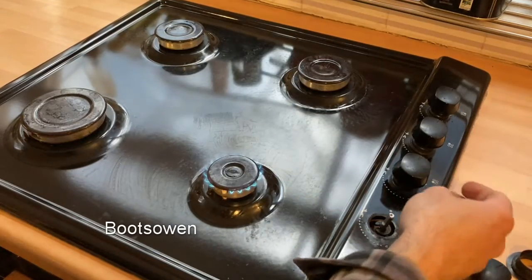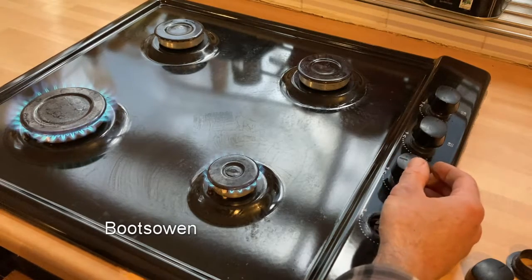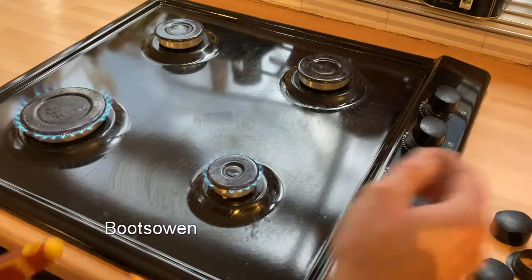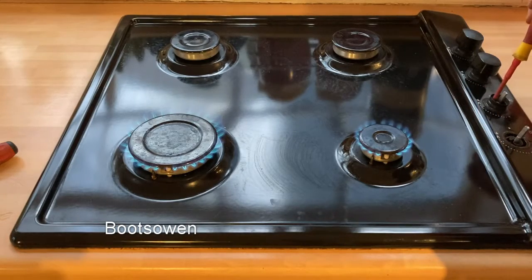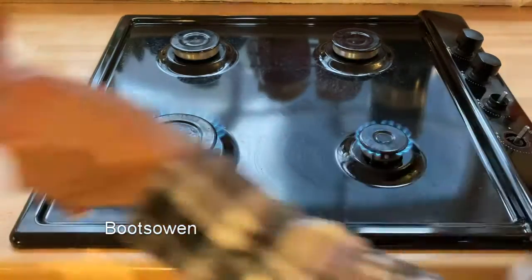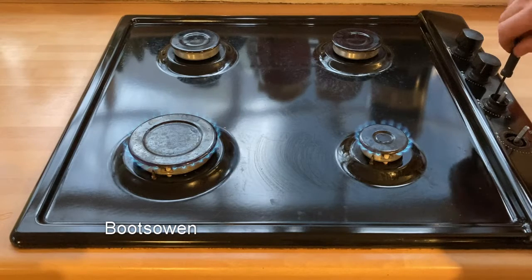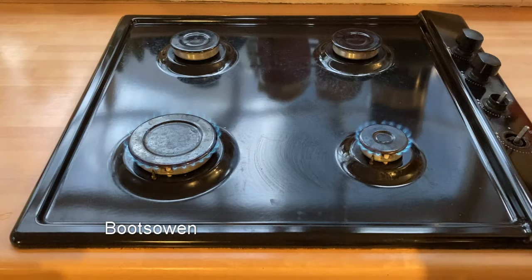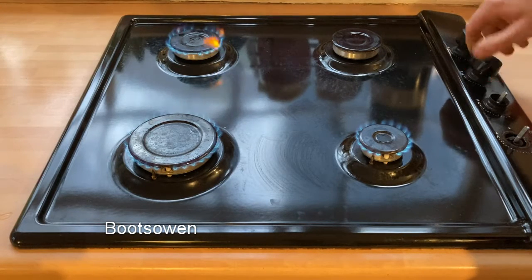So let's do it again. The big ring this time over here — that's the big flame, and it's mighty big. Turn it down; it's not much further down. Pull that off and reach in here. You don't really need to remove this rubber thing, but it might help to be able to see what you're at. Try the smaller screwdriver — it's just easier to get it in. Look at that, it instantly drops the flame ever so slightly. Better if you don't have to take off the rubber rings, because they're tricky to get back on.